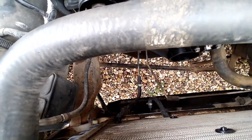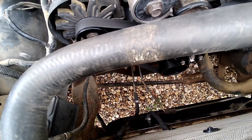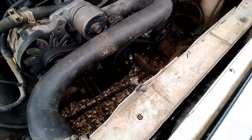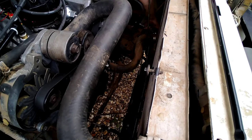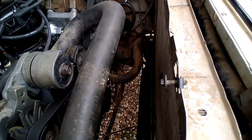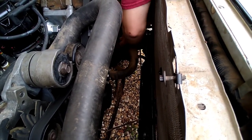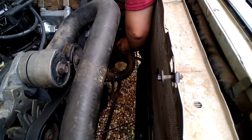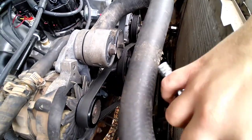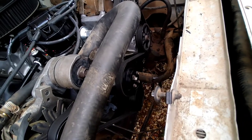The other issue I had was the way I ran my transmission cooler lines — my stock shroud was hitting. So what I'm going to do now is ditch the mechanical fan altogether, get this radiator out, and show you how to put a newer Crown Vic electric fan in. The good thing about this OBS F-150 is the Crown Vic e-fan pretty much fits this radiator to a tee — it is a little tight up here on the water pump side.